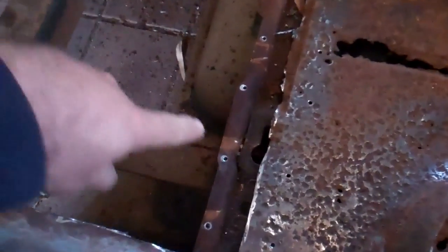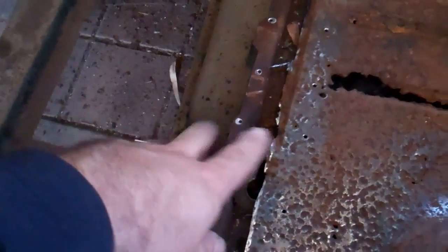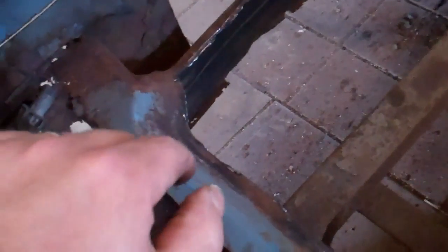So there's that brace I broke the spot welds from. There's 3 of those. Those you can buy and use. I'll see what that's like when I completely uncover it all. So that little corner piece that runs along there, that's going to have to be remade. Looks like someone's already attempted patching that up once before. It's got rivets through that. And rear brace here as well. Have to remove that as well, so first I'll get the rest of the boot floor out of there.